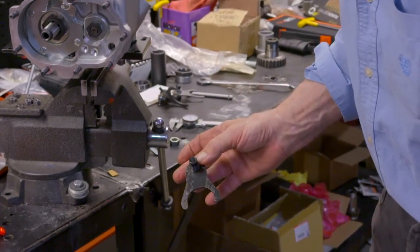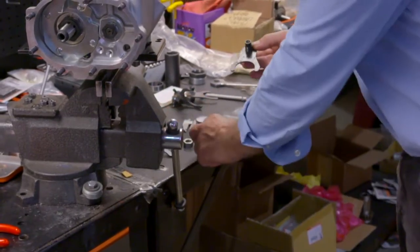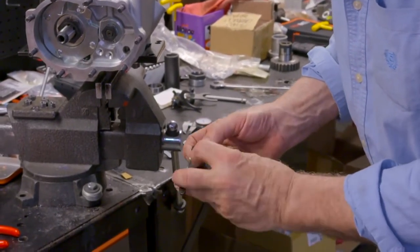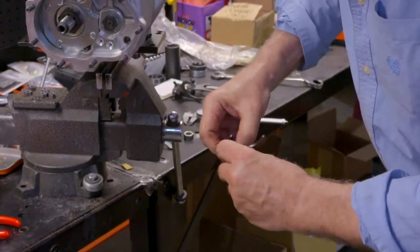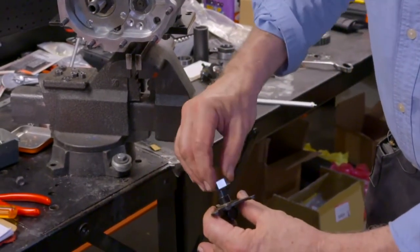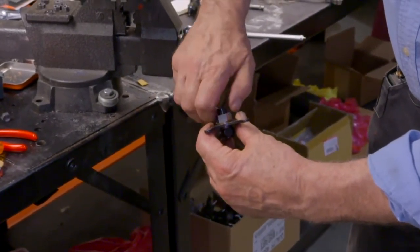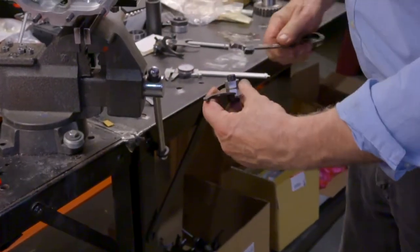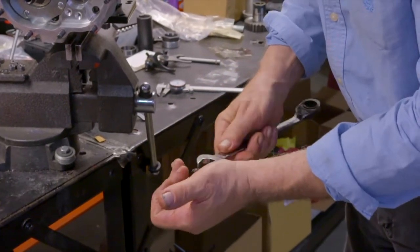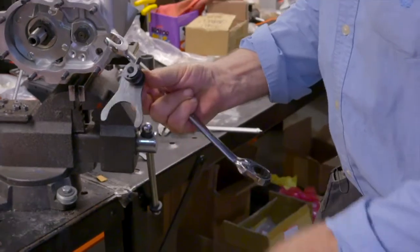Install our piece. Again, this is the main shaft, so she's kicking backward. Finger roller stud is at 12 o'clock. We now install our lock tang. Make sure it locates in the key slot. A little tricky. The recessed end, of course, on our jam nut goes toward the assembly to allow things to encase within it. And we can kind of just snug that up good by hand. We don't have to go crazy with it. That's ready for a mock-up assembly.